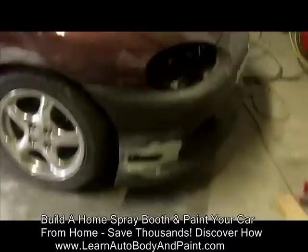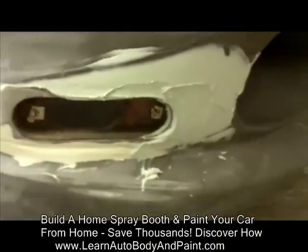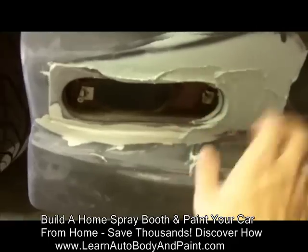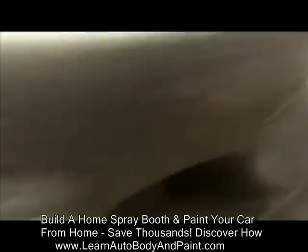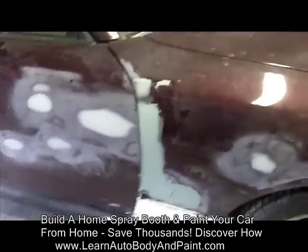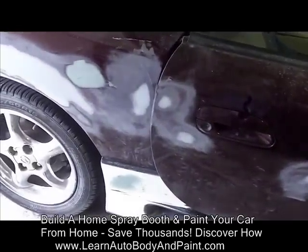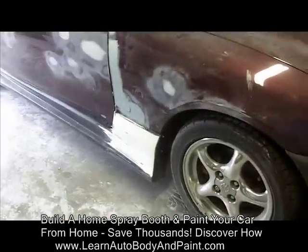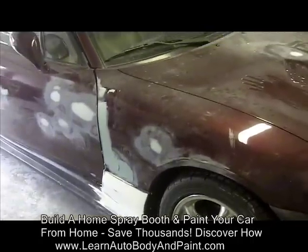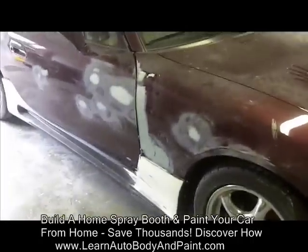So today's plan, we're gonna go ahead, finish sanding this up. Okay, we're gonna get all of our body kit things molded, our front inserts, and all of this stuff. We're just gonna hit it down with the 80 grit DA quick, and then go over everything final by hand with 80 grit block. And then when that's done, we're gonna put 150 on the DA. Just go over everything with 150 quick, get it smoother. Take out the coarseness of the sandpaper.